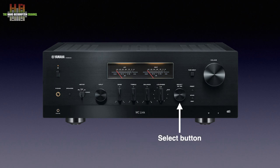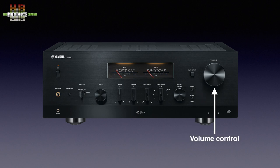Pressing the select button opens the menu on the display. Turning the knob shows menu options and pressing it again selects that option. This button lets you return from the menu; held for 5 seconds it pairs the N2000 to the MusicCast app. The preset select button lets you select FM and DAB+ stations, music on your server, and net radio stations you have programmed. The pure direct button bypasses adjustment functions — bass, treble, balance, loudness, YPAO settings and menu options — and dims the front display. When using pure direct, transmissions to the MusicCast network are not available except for network content audio and Bluetooth devices. The volume control is the largest control since it is most urgently used.